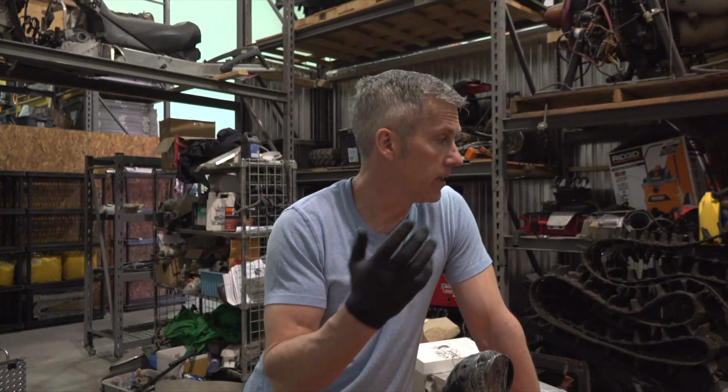You could probably jam so much power out of that electric motor that it would snap every axle and part of that drivetrain, which is basically a snowmobile drivetrain. There's a lot of torque in that. There's 180 foot-pounds of torque. So there's a lot of power, and they don't want to break the prototype. It senses super high loads in really heavy conditions like we were riding in the other day.